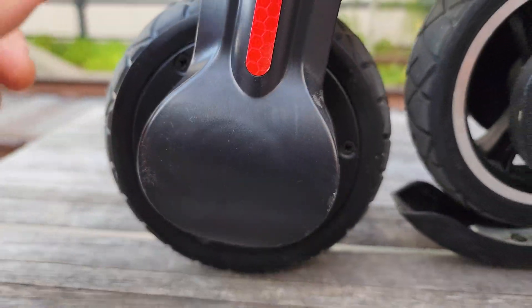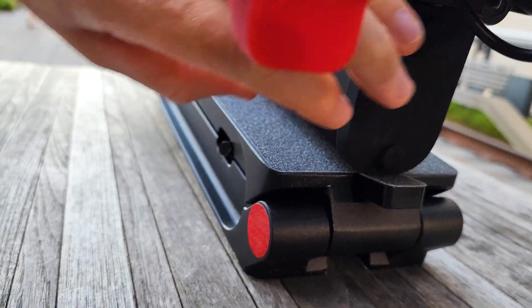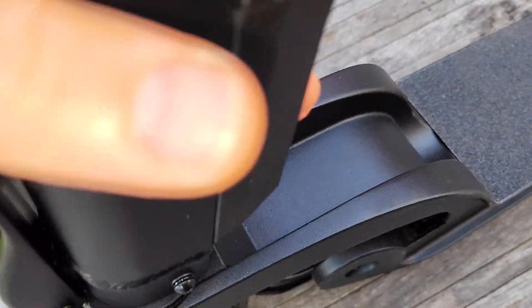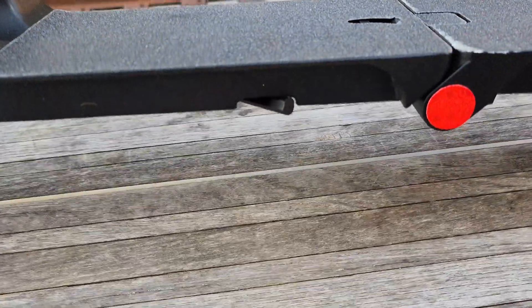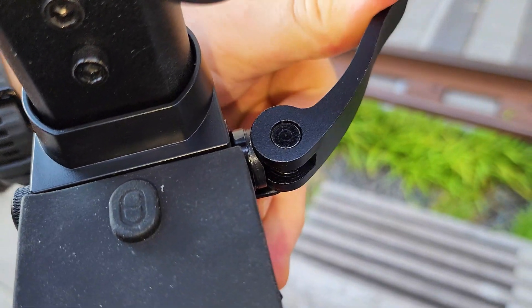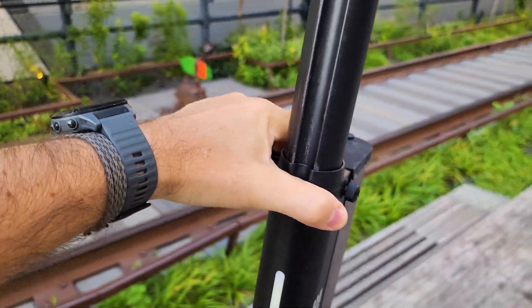There'll be less vibration and much more comfortable. I like how it folds here — it has a spring here and you press this button and it's all spring loaded. It's releasing the spring right there, you can see it moving. It clips the front by itself and you have here a set screw to adjust. Once you do that, you just lift the end and it folds by itself, locks in. You have the kickstand to hold it and pretty much lift the front. The same quick release you see on the seat post on e-bikes — and the scooter is ready to go. Very simple design, very clever, and very convenient.